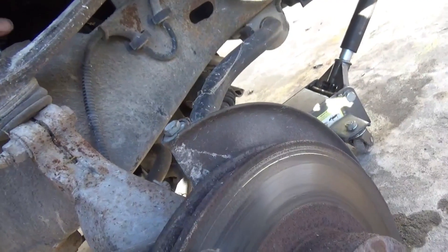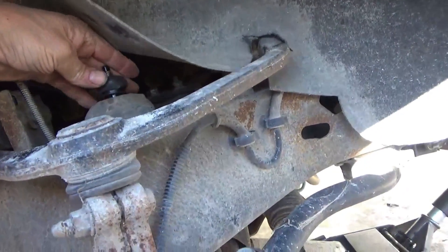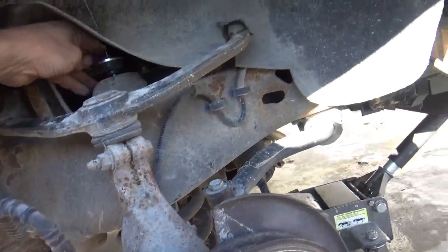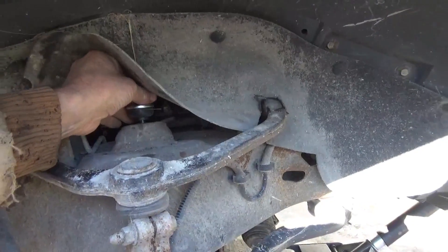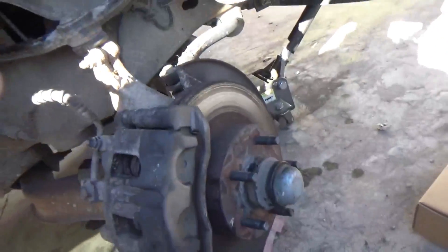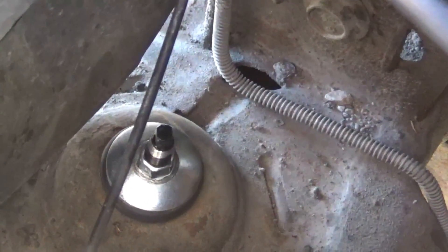So I'm going to push this one on the top — let's see if it'll go down without putting grease on it. It doesn't really matter because we've got enough thread on top that I could just put the nut on it and thread it down, and it'll just force its way down. I'm going to go ahead and tighten that down, tighten the bottom as well, and that shock is done. We'll do the same thing on the other side and then we'll do stabilizer links.